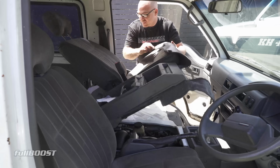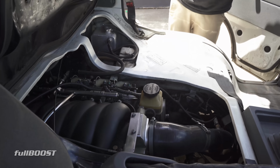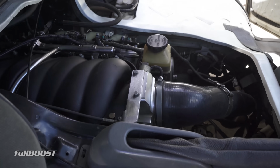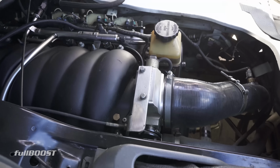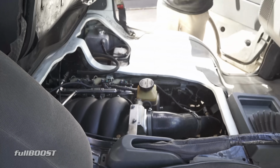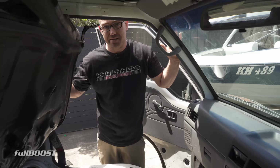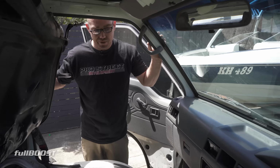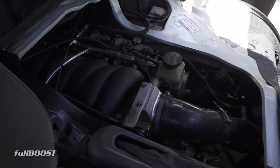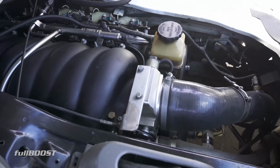Do you get any extra cabin heat at all? Yeah, sometimes you definitely do feel it coming up through the seals. In general, I've got a really big radiator. The radiator actually lays flat in the front of this car. I've got one big 16-inch fan on it. Around town, 81 degrees. It's beautiful. So it's actually probably too cold. On the highway, if I'm pulling a trailer or anything, it'll sit at maybe 90, 95 degrees.